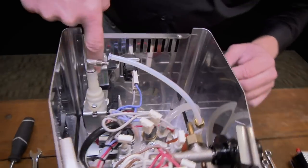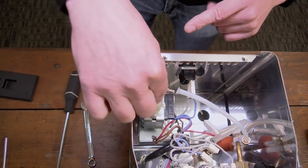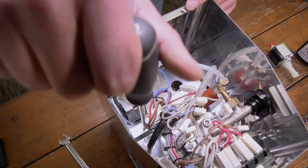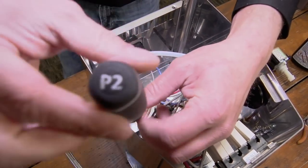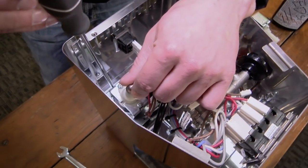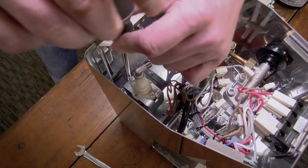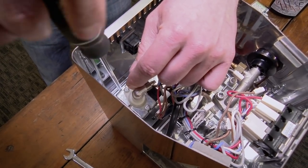Now there's a bracket down there with two screws on either side of the pump — that's what's holding the pump in place. We're going to remove those two screws, and that's why we need a longer Phillips so we can get down there on the screw. The magnet is really handy on the magnetic tip if you have it. If not, you're going to be struggling a little bit more to get them out and also get them back in, but it can be done.